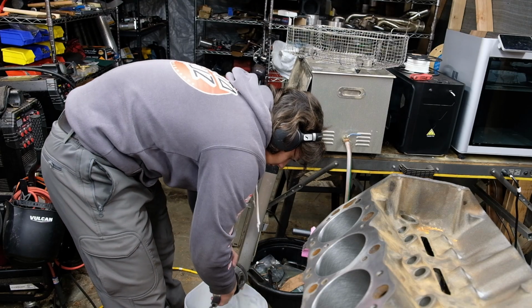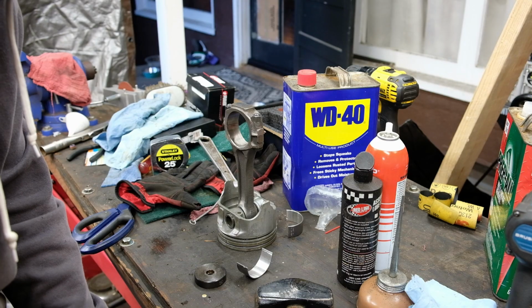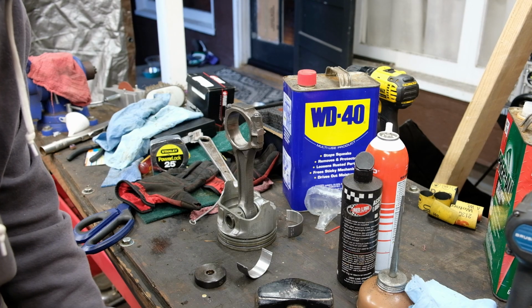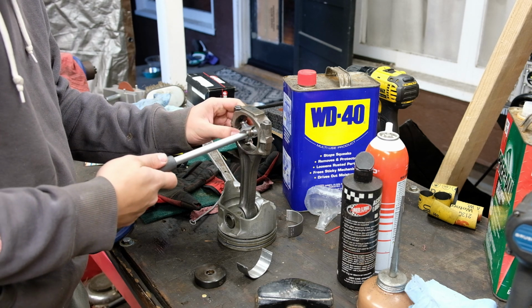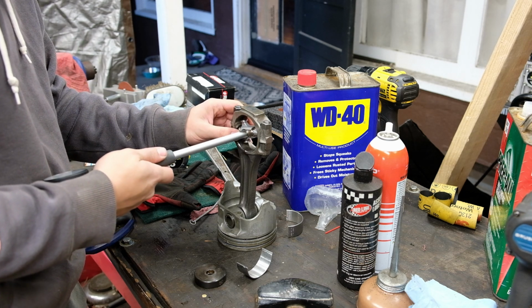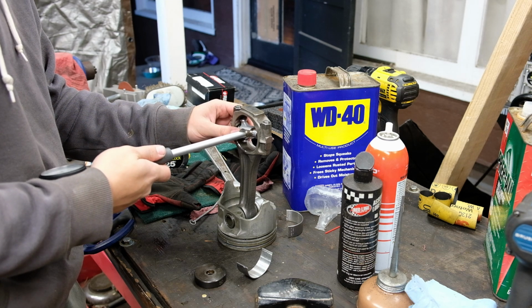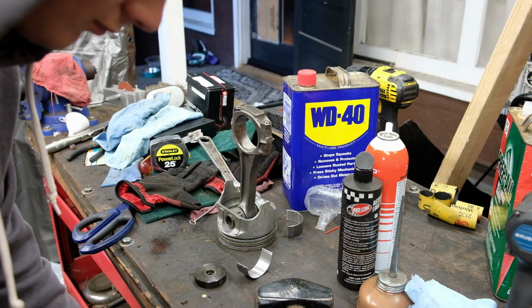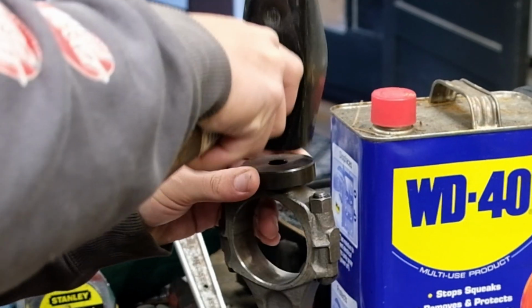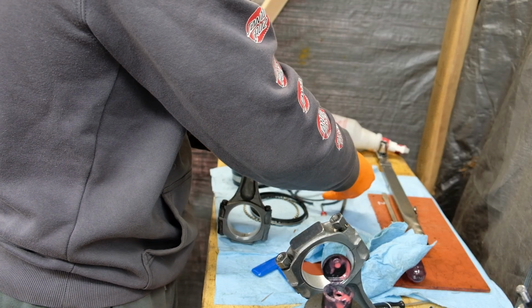The pistons took the same bath the main caps did, and this is when I checked the rod bearing clearances. They sat at around 3 thousandths vertical and 4 thousandths horizontal, which is pretty normal. I come to find out the number 7 rod is actually 12 ten-thousandths out of round, where the vertical and horizontal oil clearance numbers are actually swapped, over 6 times the maximum allowed. Funny. Anyway, pistons get their rings installed and they too get shelved until it's time for install.